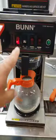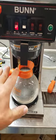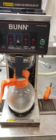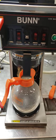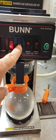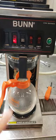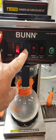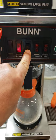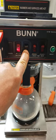Now let's say we want to decrease the water — we're having too much water. Again, we're coming up to the bottom of the collar with just water, no coffee in there. Now you want to decrease the amount. So let's say we want to take ten seconds off. Turn this on and press it five times, then hold it. Each press is two seconds. This is to decrease the amount.